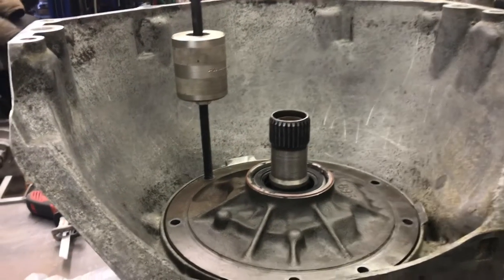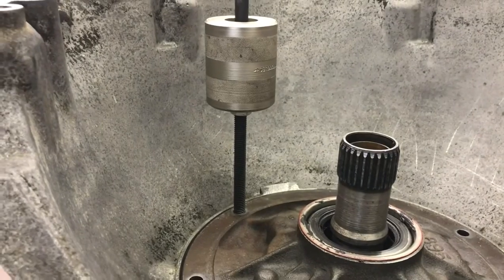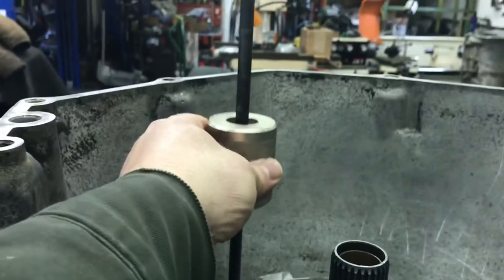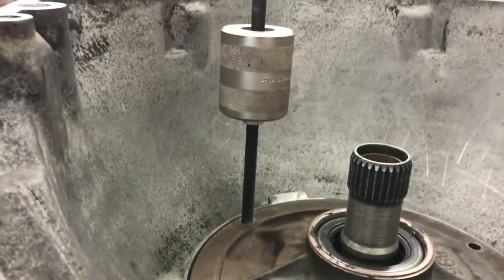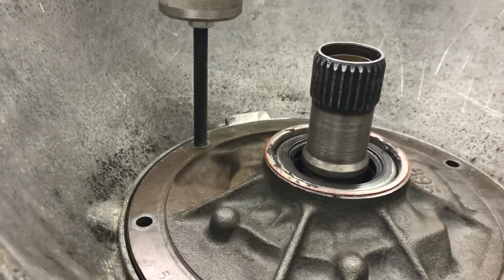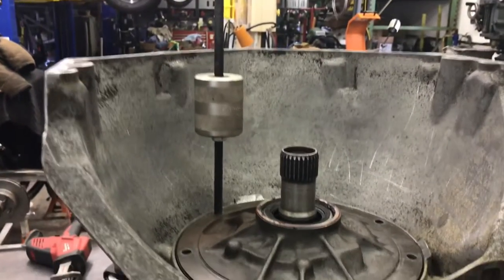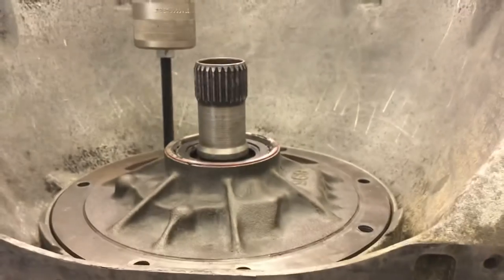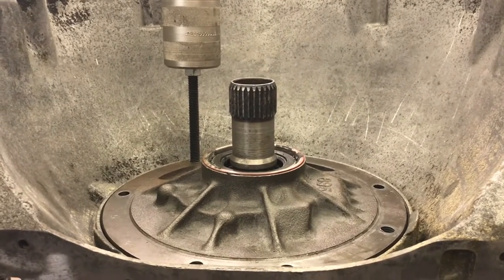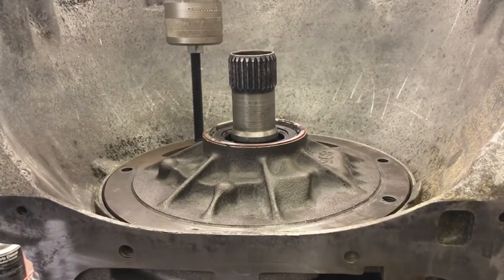I worked at two different transmission shops and we never had a fancy slide hammer. We had a piece of three-eighths all-thread or ready rod — depending on where you live — with a random piece of round metal with a hole in it and a couple of nuts. This is a Snap-on slide hammer that accomplishes the same thing. The Turbo 400 pump has two threaded holes. I like to put the slide hammer in the upper one and pry gently under the pressure regulator against the case — just light pressure and it's out. If you do just one side, go back and forth between the two. Simply prying, you might get it cocked and have trouble getting it out.